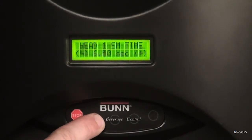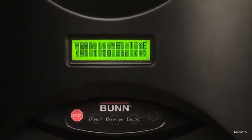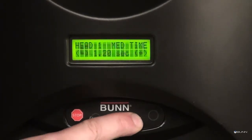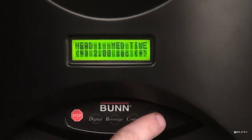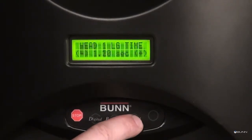Head 1 small time will be displayed along with the current time setting. Pressing either button D below minus or button B below plus will subtract or add time in one-second increments. Each one second of time equals approximately 1.25 ounces of beverage at factory settings. When the desired time is set, press button A to continue to the next cup size.